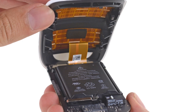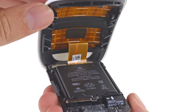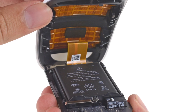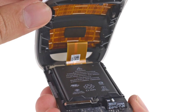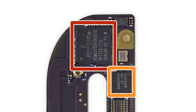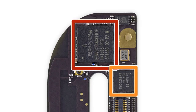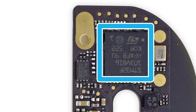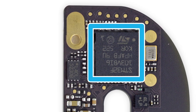With the upper casing lifted off, we get a clear look at the capacitive arrays that give the Magic Mouse its trackpad-like effect and a very large rechargeable battery. Taking a look at the logic board, we find some familiar chips. This mouse has the same Broadcom Bluetooth 3.0 single-chip solution, NXP Charging IC, and ST Microelectronics ARM Cortex M3 that we found in the keyboard.